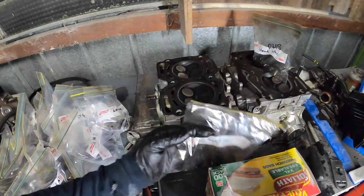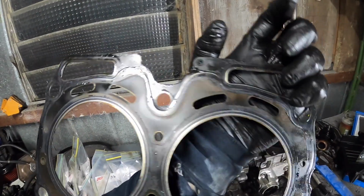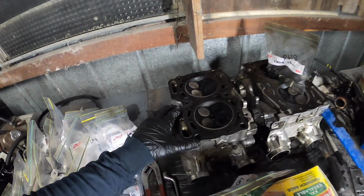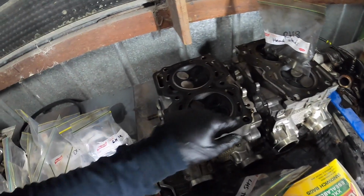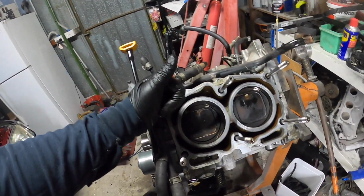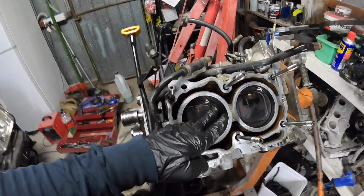I'm already using an STI head gasket, so you can see the difference already, and it never overheated with these, so you can see how much extra I could fill in. But I won't be filling in where the bolts are. What's the worst that could happen? If something's going to go, it's probably not going to be that. It'll be a rod, but they are mainly H-beams.